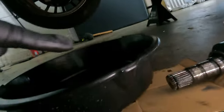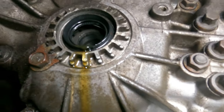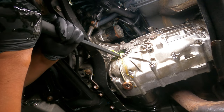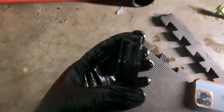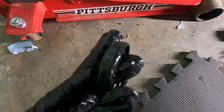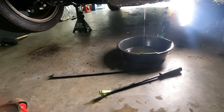We got the axle down. We have the pan to catch the rest of the fluid. Let's put the light here and see how the seal looks, because clearly it's leaking. There's some damage on it — definitely had to be this, since there's damage on it. It is there. And now it's pretty much just draining. There's not much fluid in there so I'm just going to let it do its thing.